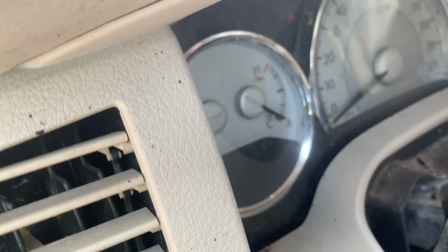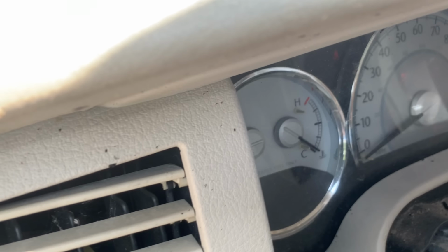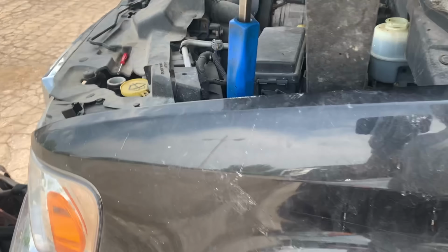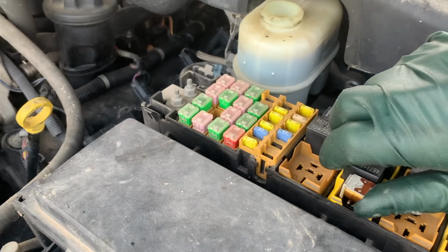I don't see an immobilizer light on in the cluster. Where's the any lights on, to be honest? It's all lit up. Why come no start? Let's look up the fuel pump and maybe we can turn the fuel pump on manually. Or maybe the pump's bad. Okay, now we need to do both of these.